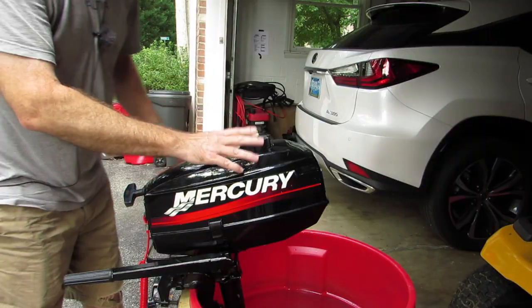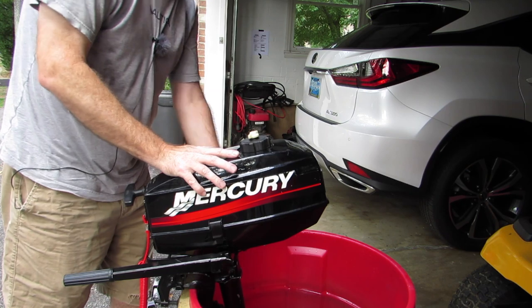I think because of sitting for a little while, mine just didn't open up all the way, or I didn't loosen it enough, or something stuck temporarily. Another way to quickly troubleshoot the cap is if you're having the same kind of problem, just pull the cap all the way off. If the cap is all the way off and the motor runs, but with the cap on the motor doesn't run, clearly it's something to do with the vent in the cap. Once I had solved that issue, everything was fine.